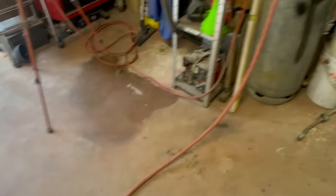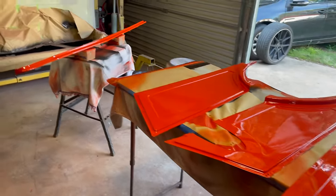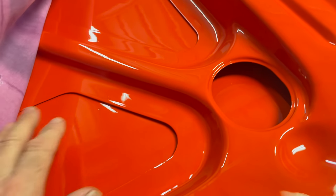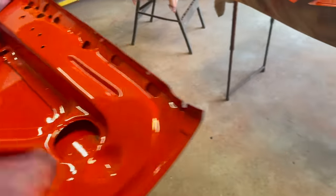And it was cooler today, and it makes all the difference. It was around 25 degrees. It was even a little bit cooler, but 25 degrees. Wow, is it a good temperature to paint? 24, 25. And the other day when I painted under the bonnet here, it was much hotter and it was really hard to do that. In fact, I had to lay the clear on very thick to get it to actually gloss, sort of get a shine to it. Otherwise it sort of gets this overspray look.